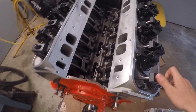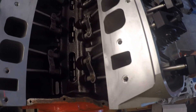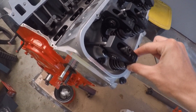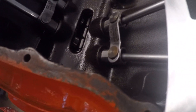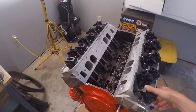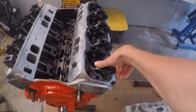If you don't know if you have hydraulic or solid lifters, if it's a stock cam you can Google it. Otherwise pull off the valve cover — if your lifters are bled down, you should be able to take your rocker arm and push it. With zero lash, lifting up on the backside by the valve spring, you should have a little bit of plunge in the lifter, which is a spring in there that pumps up when it gets oil pressure. You can do that with the intake on or off — as long as this will plunge, you've got a hydraulic setup.